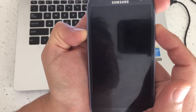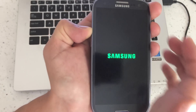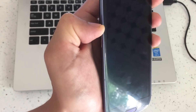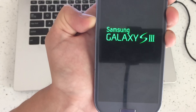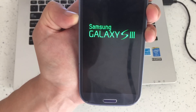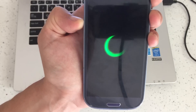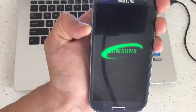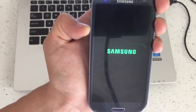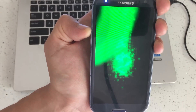I'm going to push the power button here. My phone is on now and I let go of the power button. I'm going to continue to hold the volume up button all the way through the complete boot up process, and I should be out of safe mode. That's the second way to do it, and in a second I'll show you the third way.